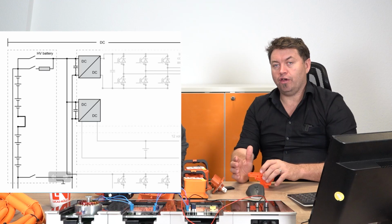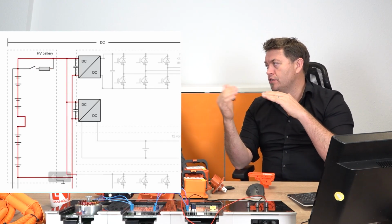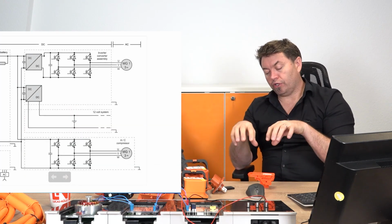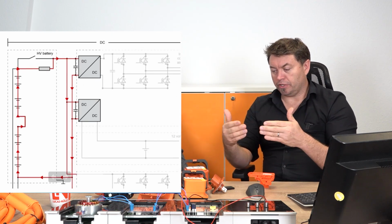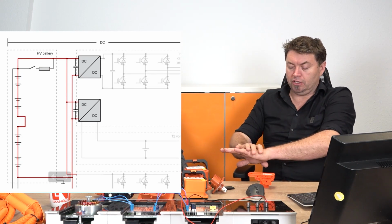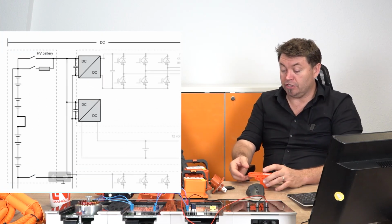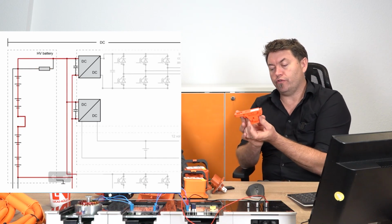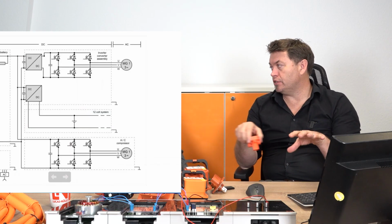and here in Germany, you have the DGUV on level 3S, I mean EV4. That's when you're working on the high voltage battery, and you often see that in a case like that, you need the full face shield, long sleeves, the full equipment, because the danger is, again, it's now a live system, and you have to open the manual service disconnect, because as we said before, this splits the battery into two pieces.